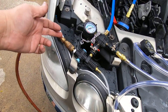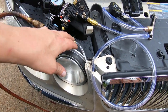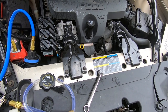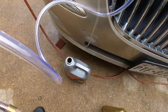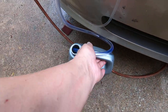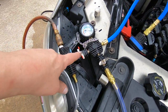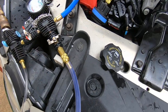The theory is: I've got air pressure here, this little valve draws a vacuum as it's running through — it's a venturi effect. It draws a vacuum and when I open this it should pull a vacuum on the cooling system. Now this is not an empty cooling system but it is very low. You put this end in a bucket of coolant — there's not a whole lot left in this one but I've got another one on standby. Once I pull a vacuum on it, I'll shut this valve off, open this valve, and it should suck coolant up through this hose and into the cooling system.